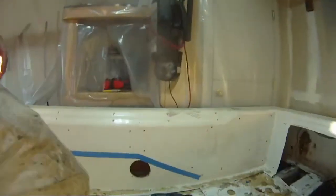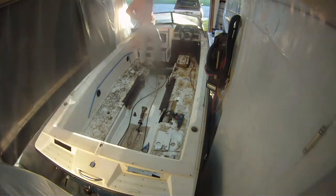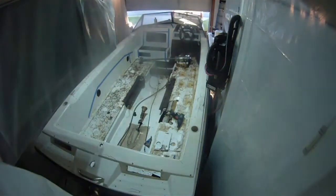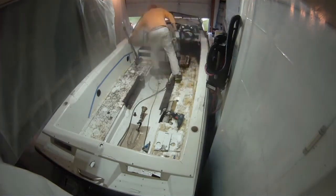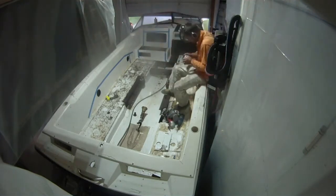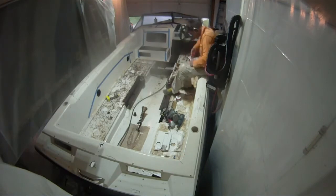When I started mapping out this boat project I knew I had an issue. The deck, the top of the boat, comes all the way down to the floor all the way across, like you can see here. That was going to make it really difficult to cut the floor out and get underneath it for the flotation foam. So either take the whole deck off the boat — thank God I didn't go that route — or I needed to make these cuts, these openings in the side, to allow access where the floor meets the siding of the boat and get the cuts in from there.